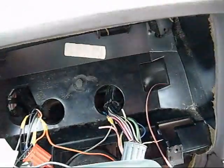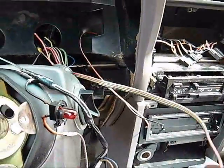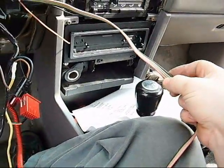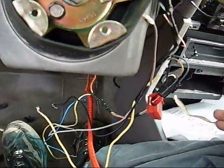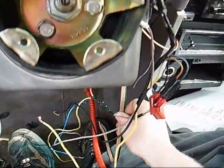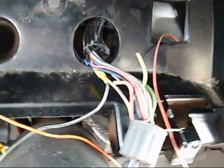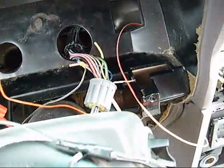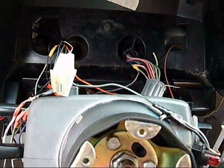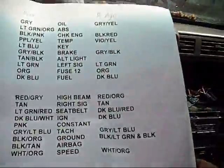Looking towards the future - he wants to get an aftermarket tachometer that we can mount on the dash because he doesn't like the digital tach as much. So I'm actually running wires now that will be for the tach later on. This little ribbon of four wires I saved from a broken turn signal switch assembly at the boneyard, because it's a big solid ribbon - really useful. I've already tapped it into the tach wire. You can find a wiring diagram for your car - that's the easiest way, otherwise you do a lot of hunting and pecking. A lot of Dodges from different eras use the same wire colors.